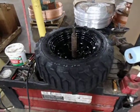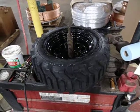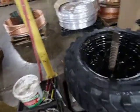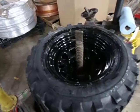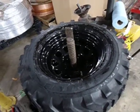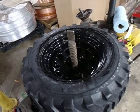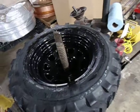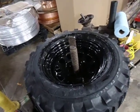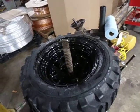I have a little update on the new tires and wheels for the two-wheel scraper. I mentioned a few videos back I was having a real tough time finding the correct wheels for these tires. I needed an 8-inch wide rim with a 6 by 5 and a half bolt pattern. The tires are 15 inch. For some reason I couldn't find those things, but I got back on the internet just screwing around and lo and behold I found them in about 3 minutes.